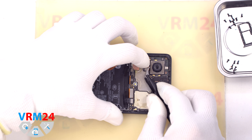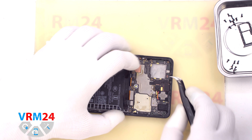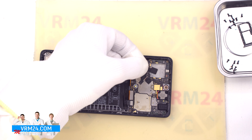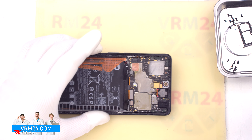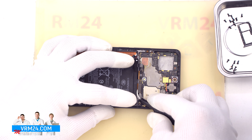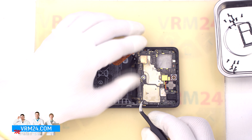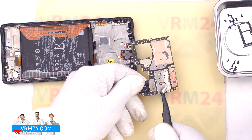By the way, the subboard is slightly recessed. On the subboard we have the microphone, charging port, and other elements on the back side. In our traditionally quick test of the microphone hole — we take the tool and try to insert it into the microphone hole, but we are hindered by the gasket which is located in the microphone hole. Also, please note that the microphone body itself is located on the subboard on the opposite side of the microphone hole. Accordingly, even if we can insert something into the microphone hole, we will not be able to damage the microphone in this way.